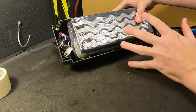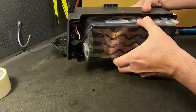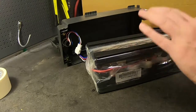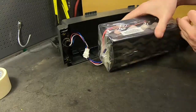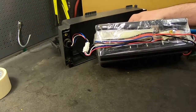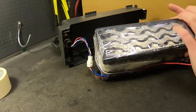Here you can see the whole battery pack is enclosed, not in heat shrink tubing, but a plastic bag. This looks like the plastic bags you get when you buy a wine bottle as a gift. I think these look exactly the same. They're using this to protect against water and it's actually extremely good at protecting against water. You don't need heat shrink tubing. This one is folded and glued at the bottom, and on the top it's twisted and folded with a lot of silicone. So it's just impossible for water to get in. And I also like that it's transparent so you can actually see.